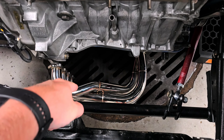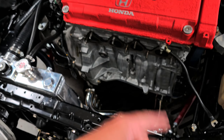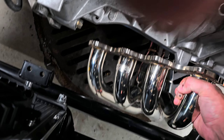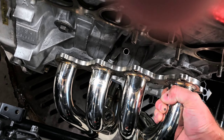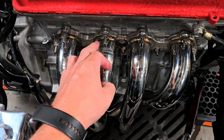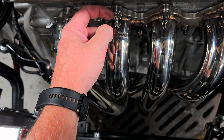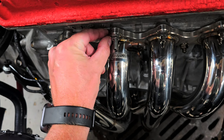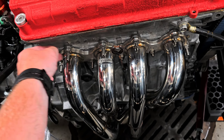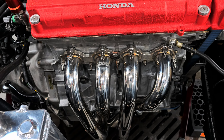These have to get brought up from the bottom side. It's pretty much impossible to get it in from the top without scuffing things, so it's easiest to just bring her up through the bottom. We did have to actually change a few of the studs because the flat spot on the stud was past where the nut starts — the flange is thinner than the turbo manifold we had on here. So we swapped out the studs that were the wrong length, got them on there, and now we'll go underneath and see what's up.